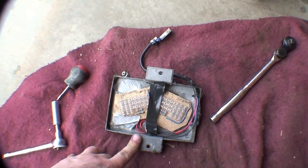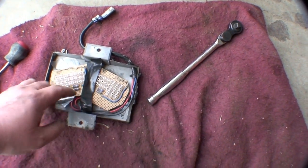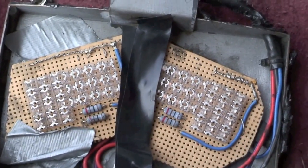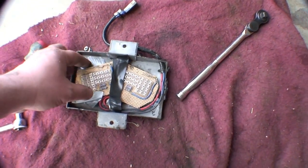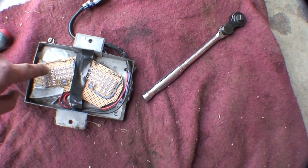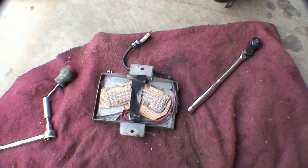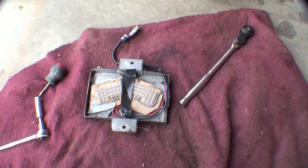I don't like this setup — I'd like to get something better. All these LED lights are soldered individually into the circuit board. Over time, riding the bike, the vibrations break the solder points between them, causing sections to break out. Once one solder breaks, one section of the lights quits working — that's what happened here with the flickering. We're going to bust out the soldering gun, re-solder that ground wire back on, connect it to the bike, and see if it works.